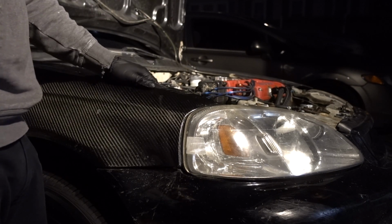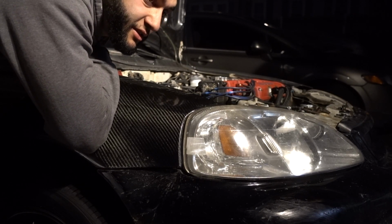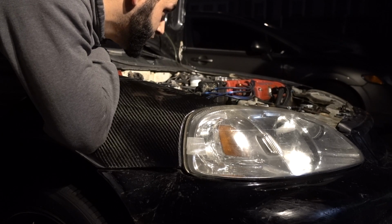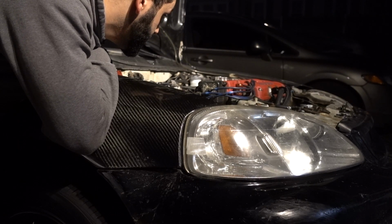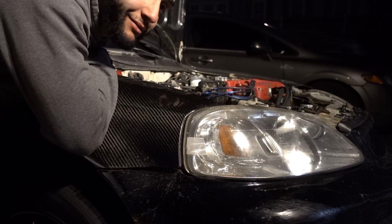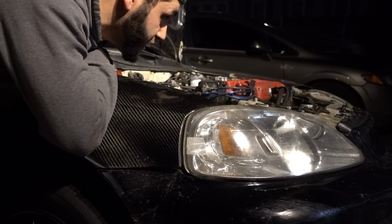Bogs out a little bit on the low end, but when it hits top end, it's like I told you guys, that's why we have to rev it so high, because after 7600, that's when she starts moving. She opens up hard. Like literally the VTEC, I tried lowering the VTEC, and I'm telling you, it did not like it. So I raised it to 5800.